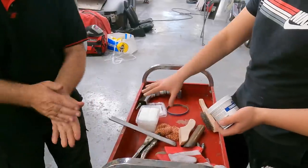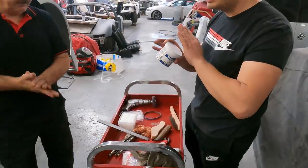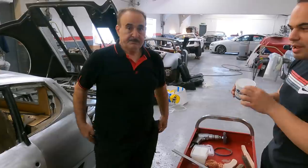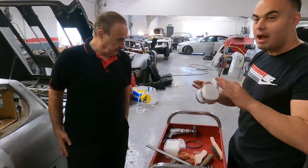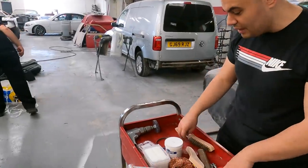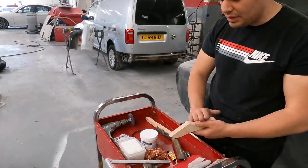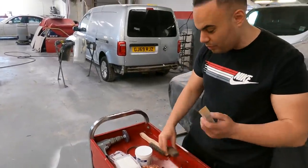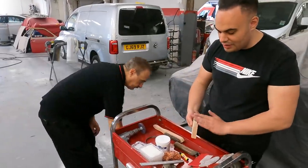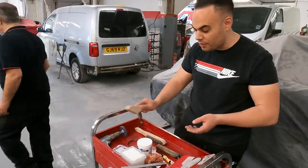Before we get started, it's very important to make sure that all of the metal surfaces are as clinically clean as possible. Any bits of debris or dark spots need to be fully ground out before we even think about leading. This is the leading kit. We've talked through the tallow process: heat the tallow, make sure the paddle is clean, heat it slightly, then dip into the tallow. Wipe the tallow slightly to form a very soft film. You don't want anything too shiny or too thick, otherwise it won't grip properly.